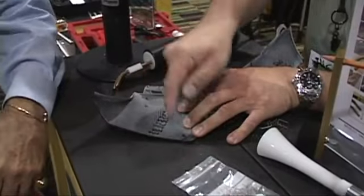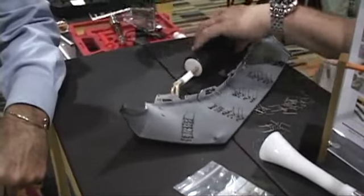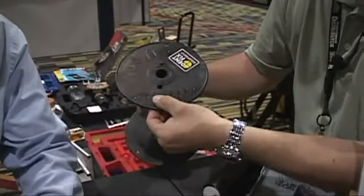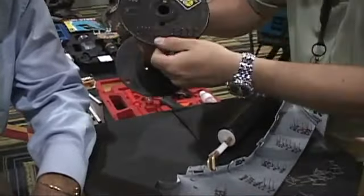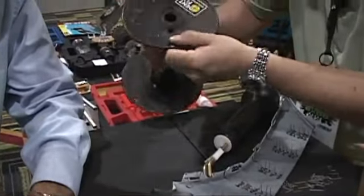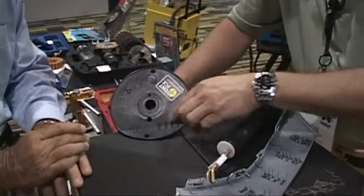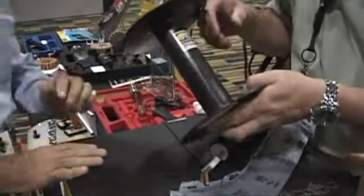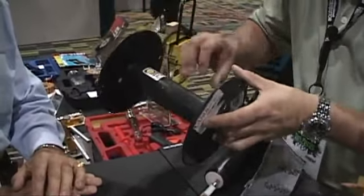When you're done, you go ahead and clip off those clips, and you get a very strong structural repair. In this instance here, I've cut this spool apart and put staples in here — now I get strength and flexibility. The flexibility is important for when you're trying to fit the part back on, and it creates the strength. I can also use it on structural repairs, such as a headlight assembly on a clip or on an air box.